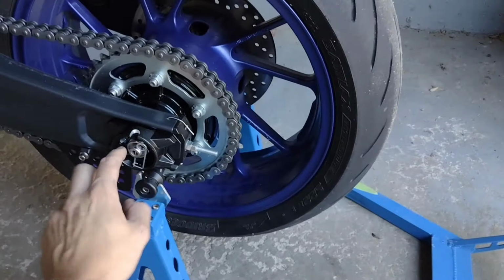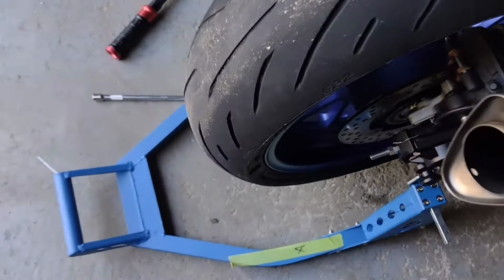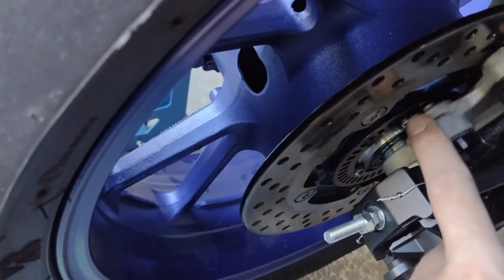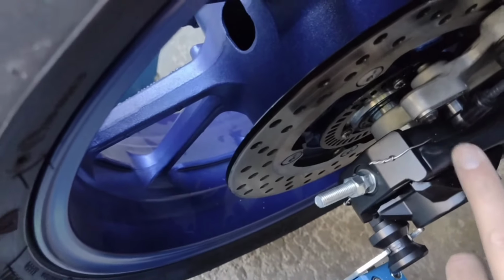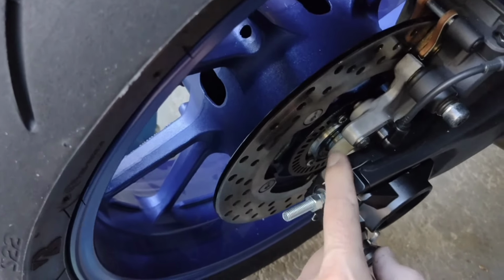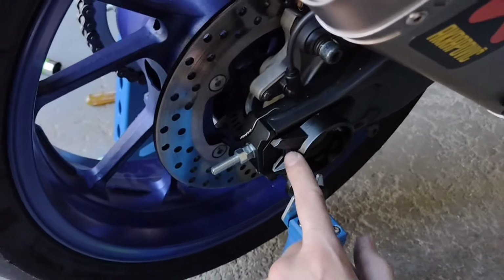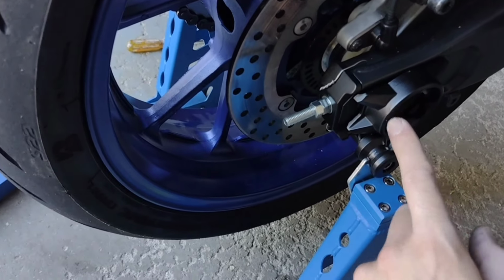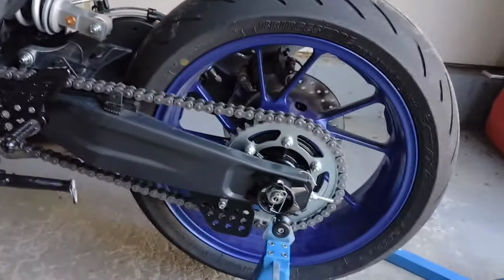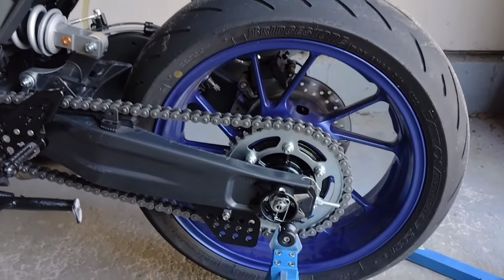So, really liking the effect of these not dropping away, both sides. The main struggle's really, like I say, keeping this spacer in there, and also the alignment of this brake assembly to the axle. It wants to move around and slide about, so you've got to try and realign that again. But other than that, it's not too bad really. I feel that's a pretty quick time, and it definitely helps having these stay in position, and single-handedly pushing the axle through is a lot easier. So I'm going to call that a win and a success so far. I'm happy with that, and especially when I get those captive spacers installed, that'll be even better.